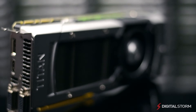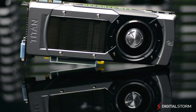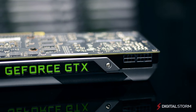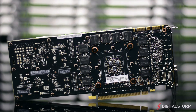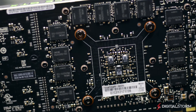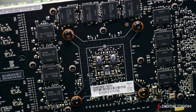Matching the raw power of the GTX Titan, the aesthetics of the card make it one of the best looking cards available on the market today. The GTX Titan features 2688 CUDA cores, an 837 MHz base clock with an 876 MHz boost clock, as well as a 6008 MHz memory clock. On the bottom of the card, you can see 12 of the 24 memory chips that make up the total of 6GB of RAM of the GTX Titan. It's this absurd amount of RAM that helps set the GTX Titan apart from its competitors.